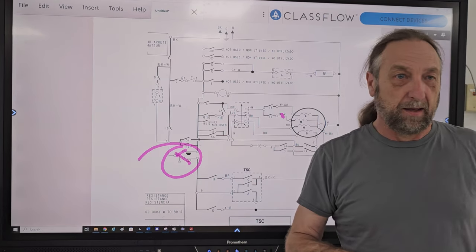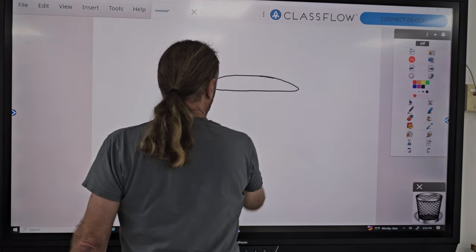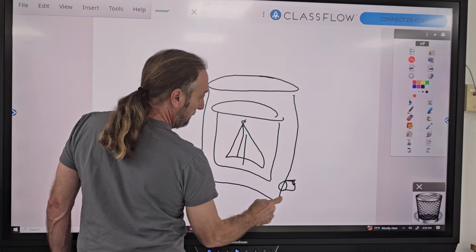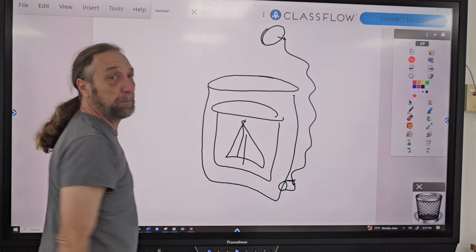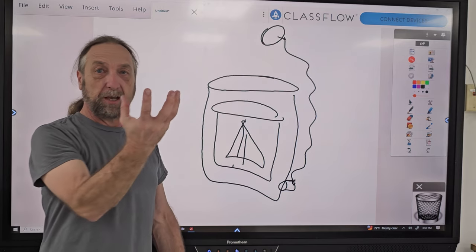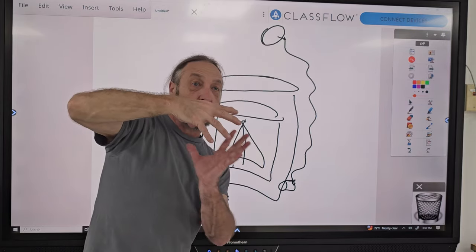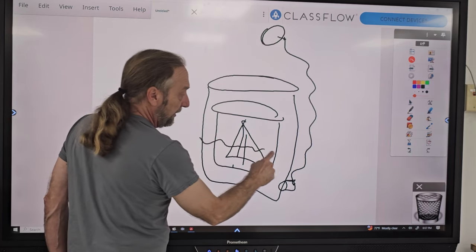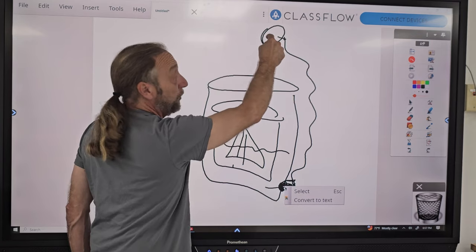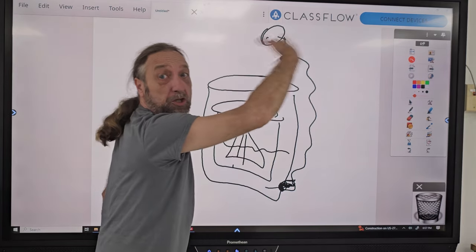But what they did is that on the side of your tank, and I'll give you a little example. Here's your washing machine tub. And then the basket's inside, and then your agitator's here, right? On the side of your tub is something called an air dome. And there's a plastic hose that runs all the way up to the water level switch up here. So as the machine starts to fill with water, that water wants to go up that hose, up to the switch. But just like if you took a cup upside down in the sink and pushed it down, air would be trapped in that cup. The deeper I would go, the increased pressure that would appear in that cup. So as water started to fill up, it'd want to go in here, but it only gets about halfway because the opening's at the very bottom, but the air inside will be trapped all the way up to here. The more water I put in, the increased pressure I would put on that hose, and that's how that switch switches over, okay?